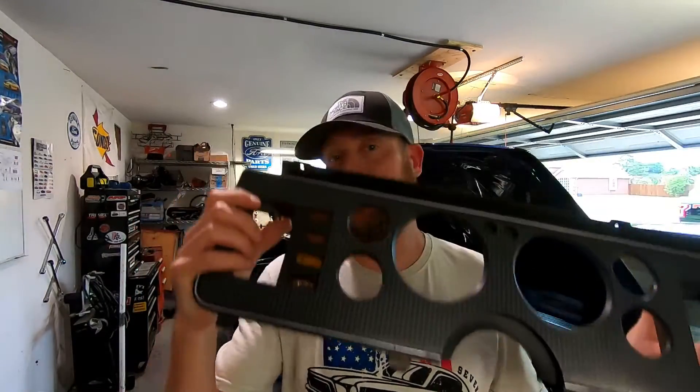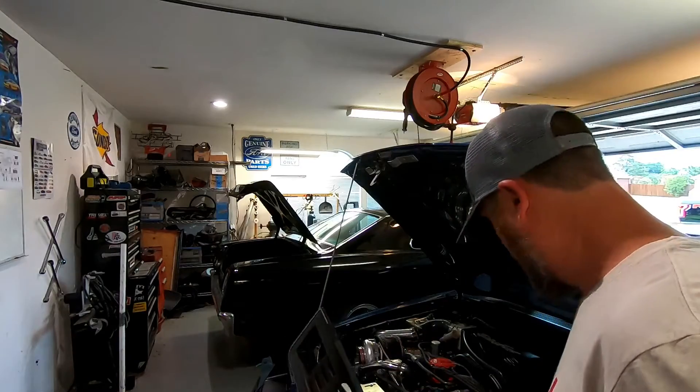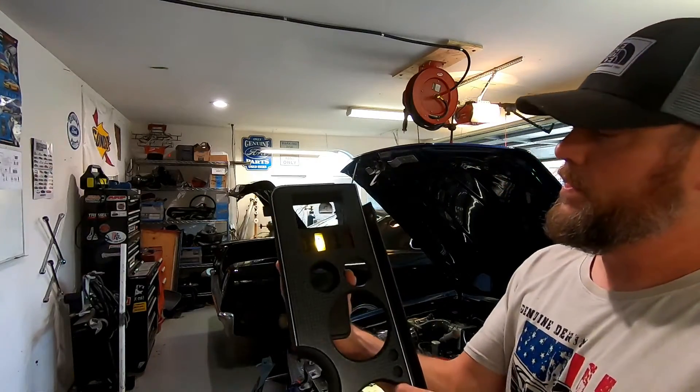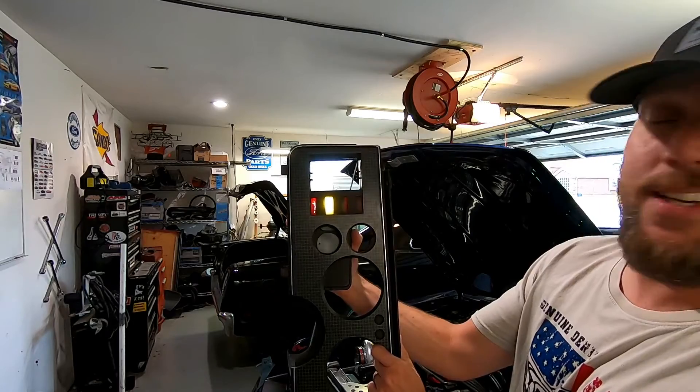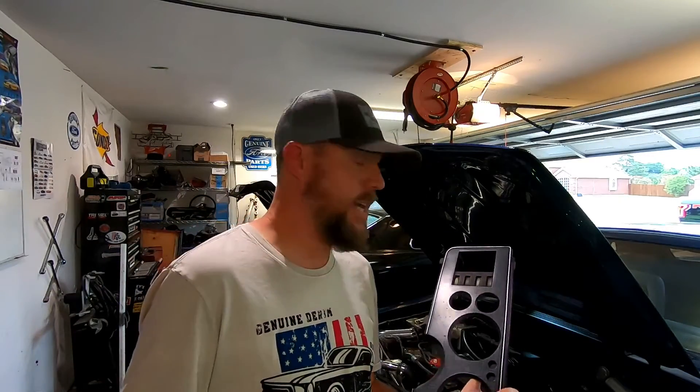It's got programmable outputs on it. And on top of that, if you have an 86 like mine, you've got a shift light built into your warning LEDs. This is a spare panel I've got here, and the second light in the bottom is an actual shift light that says the word 'shift.' I think it's there on all of them because mine and the spare one both have it. I believe it's for the SVOs, but not wired for a GT with a five liter — I could be wrong. Nonetheless, I thought it'd be really cool to see if I can use this stock shift light and wire it up.